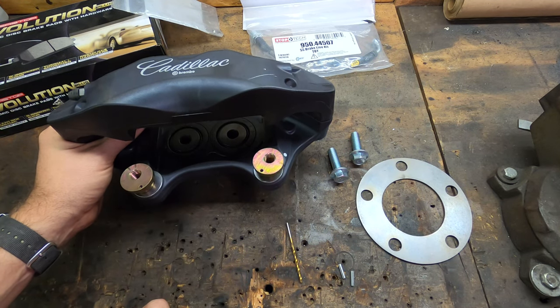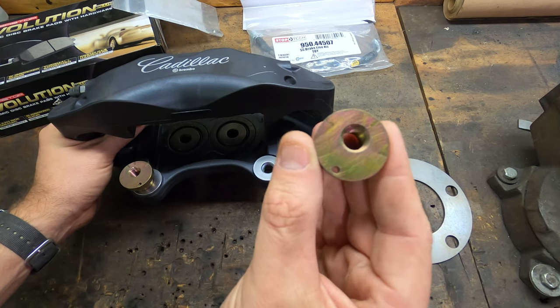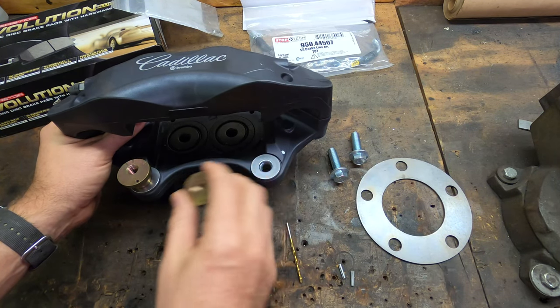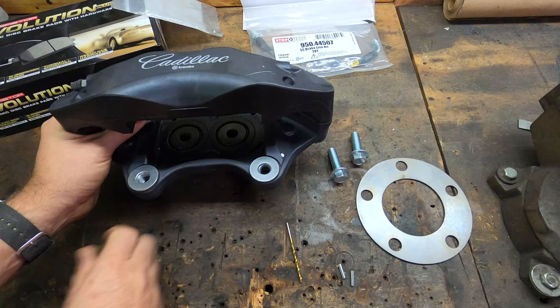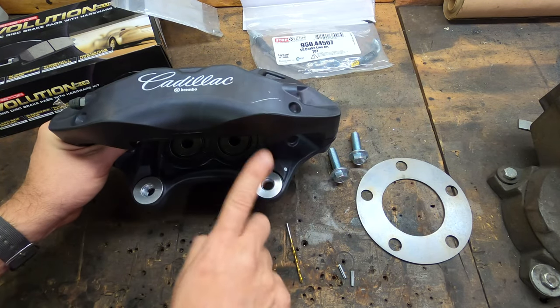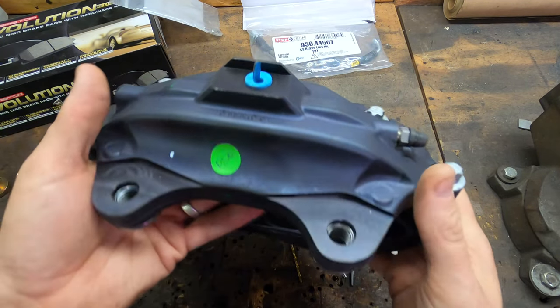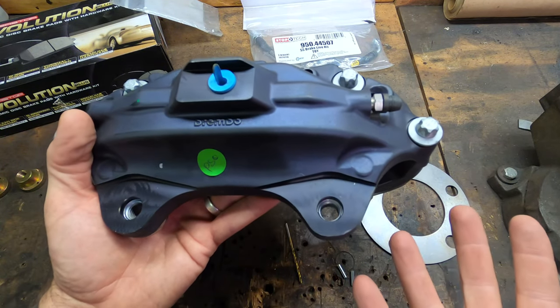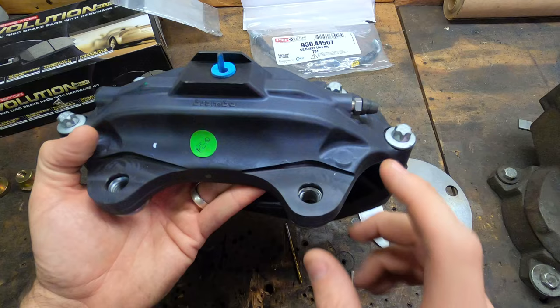The Cadillac mounting points are narrower than they are on SN95. To make up for the difference, you either have to drill out your SN95 holes — which we're not going to do — or put in these offset inserts that'll essentially space it out. SNS says you need a 14-millimeter bolt to thread in and then hammer the factory inserts out. That's how we push them out.